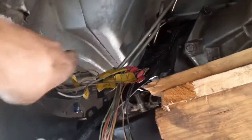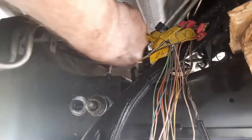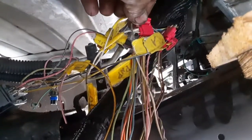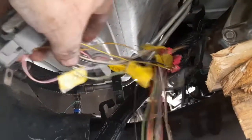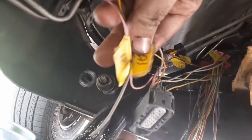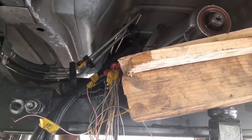All right, finally back up under the truck with my transmission installed. What I did was take the external neutral safety switch wires and use little vampire connectors to temporarily hook these all in just to test. If it works I'll solder everything in and make it look good — do it the right way. So I've got everything connected. I ran wire 11 and ground together to ground. The three that are not connected are wires 12, 10, and that yellow one. I'm going to finish this up, put some oil in this thing, and see what happens.